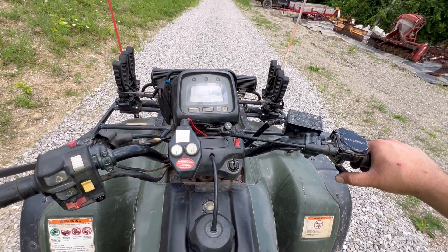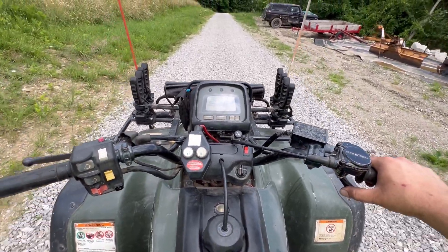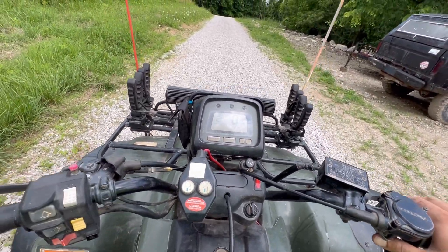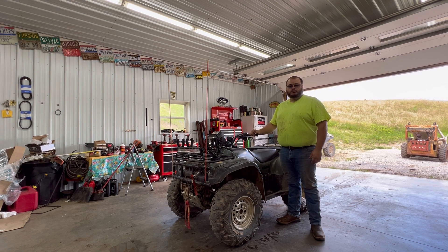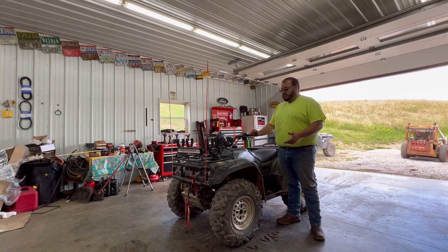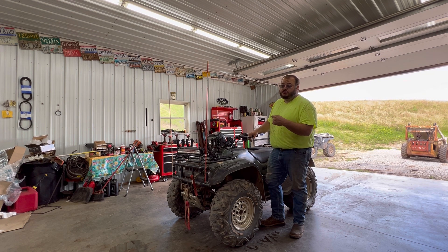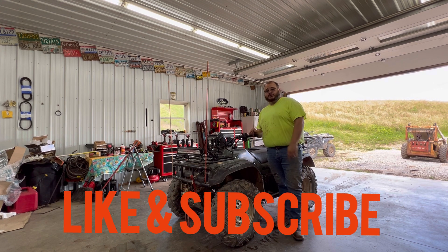I owned one of these bikes brand new in 2002 and the brakes — even the factory drum brakes — never were great. Like they might lock the wheels up sometimes, but it was rare. Yeah, they're getting better the more you use them. There you go — there's converting a Honda Foreman 450 front drum brakes to disc with the Super ATV kit. Grant this here, I use factory 12-inch wheels. If you had 14-inch wheels or even possibly just aftermarket 12s or the stock steel 12s, you wouldn't have to grind anything on them — they would just fit right on there and bolt on fine. It's these factory Honda aluminum wheels that are the only ones you've got to modify. Yeah, there she is, she's converted over. If you guys like videos like this, go check out the rest of my channel. Thanks for watching.